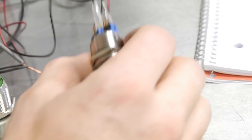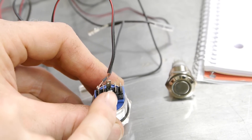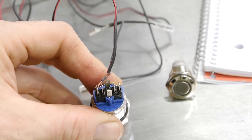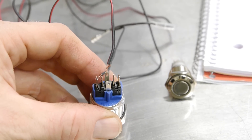Just a warning here: when you're wiring up one of these six-pin latch switches, never connect positive and negative to the top and bottom terminals. It will short your switch out and it will be broken forever. Ask me how I know.